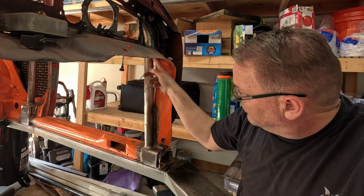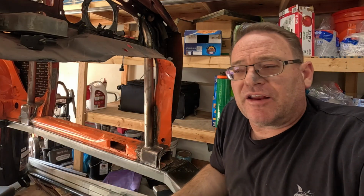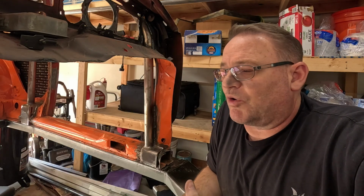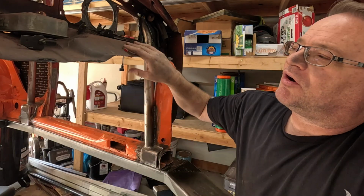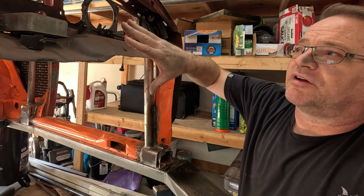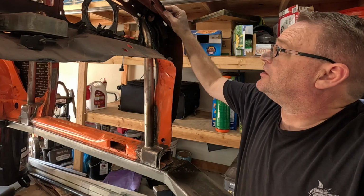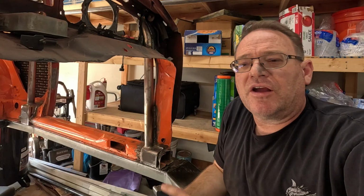I would like to basically run a tube underneath the dash back and across the dash to the other side, and I will attach my dash to that. Can you imagine just driving on regular city streets and hearing that rattle all the time? No. So I want to run a cage tube across, tighten that up, weld it basically to the dash, solidify all of that, get rid of whatever is rattling, and then put on my front clip. Once I get the front clip on, I want to put the cage work as high as I can go to make it seal against the standard body, so that this whole area, including all the wiring and everything in there, is going to be completely sealed from the elements.